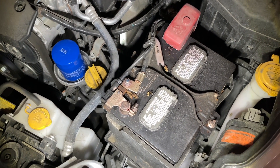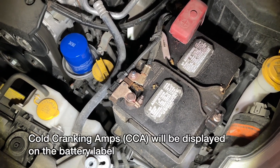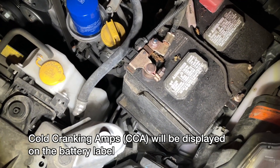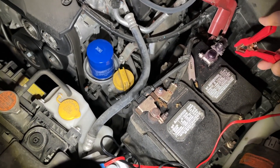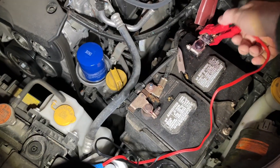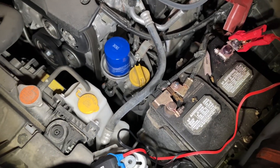This is the battery in my 2017 Subaru Outback. This is the original battery — it's almost five years old. It's a 356 cold cranking amp battery and it's a flooded battery. I'm going to remove the cover on the positive side, then connect this up to positive — and if your terminals are dirty, you'll want to clean those. I'll jiggle them a little bit to scrape away any protective coating to get a good bond, then connect the other side to the negative.